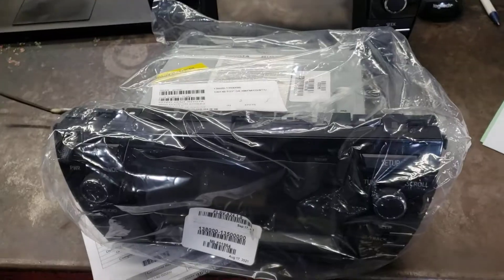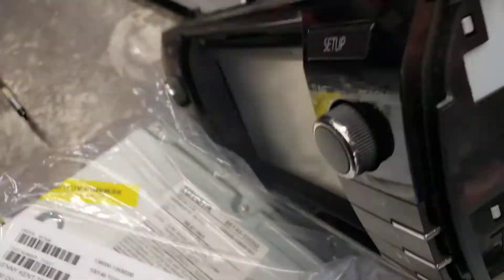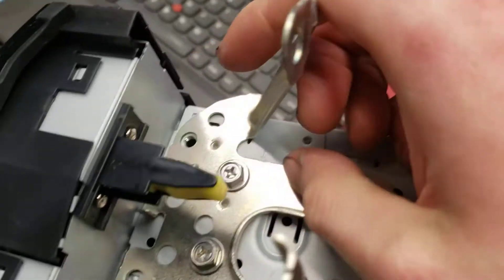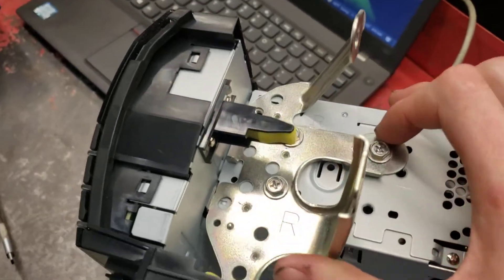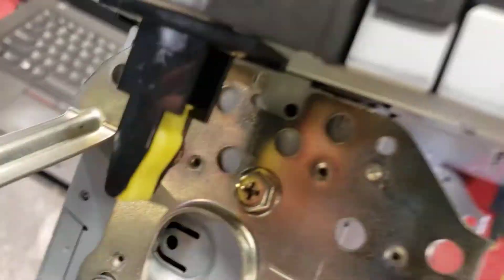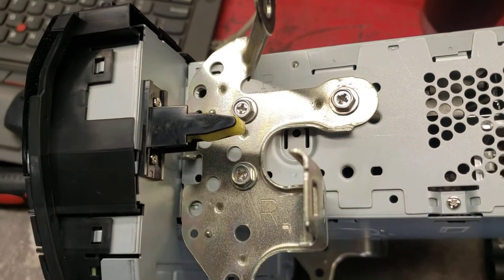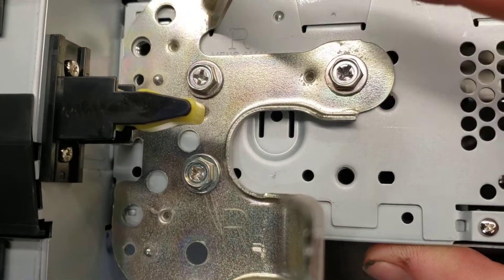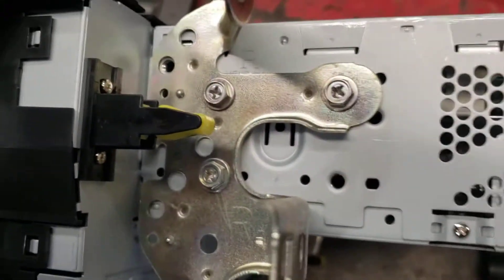Now you're ready to go on with the new radio. Here's the new one, here's the old one — we'll need to switch over the brackets. Fairly simple, three screws and off it goes. They're even labeled: this is the right side, and this is going to be the left side. I'd recommend don't use a Phillips head because you'll start to round the screws — take an 8mm socket to get them off.